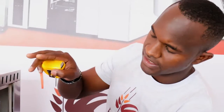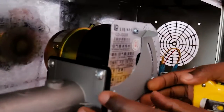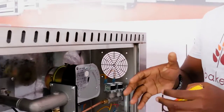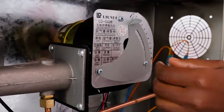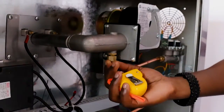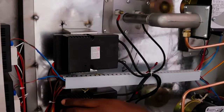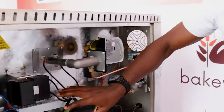The oven heats up via an upper heating tube and a lower heating tube. For the upper tube, there is a regulator for the flame — think of this like a stove where you need to tune the flame to give a blue, high-quality flame. So if you notice the flame going yellow, you open here and adjust the upper flame, and you do the same for the lower flame. Each compartment also has an igniter — upper and lower — whose job is simply to ignite the gas.